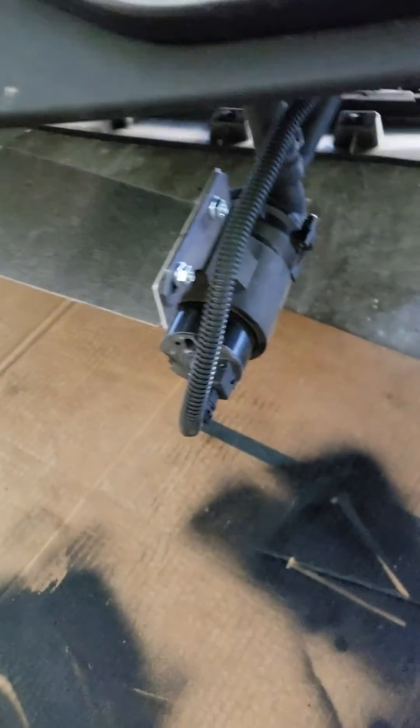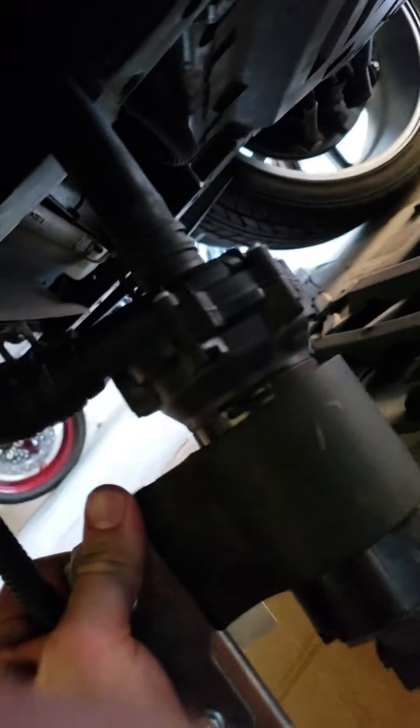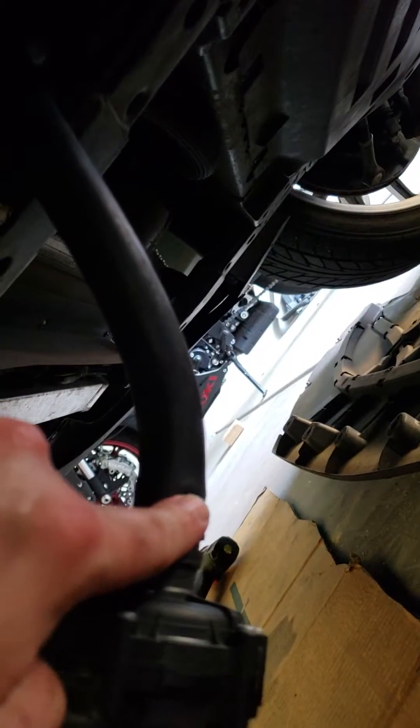Maybe I'm an idiot and I mounted it upside down, but the way they have it mounted — I mounted it off the picture and instructions — it's so dumb. Because the way it mounts, the inlet is facing so the flow's gotta go uphill into the pump and then through the heat exchanger.